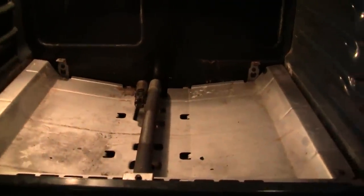On these ovens, I've taken the bottom pan out — there's a burner and a little glow igniter, called an oven igniter or glow bar on the parts list. What happens is you turn on the oven and that electrical element gets really super hot. I believe once it gets hot enough, there's probably a thermocouple or something that triggers the gas — basically signaling that the igniter is fully on.